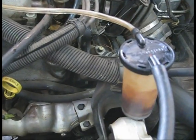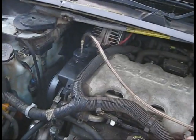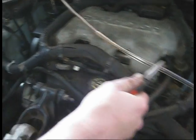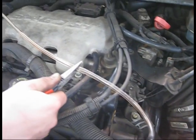This keeps the transmission flow from going into the engine. Now the GM procedure for this calls for using a vacuum pump, so this seems to make more sense. With the engine switched off and the vacuum trapped at the power steering pump, we stand here for five minutes and let those bubbles come up out of the fluid so we can finish bringing them out. We pulled a little fluid into our tank here, but not much.